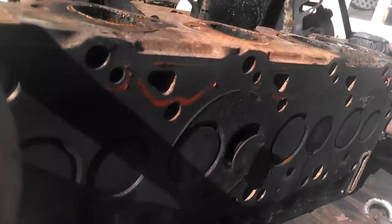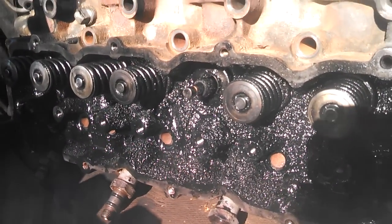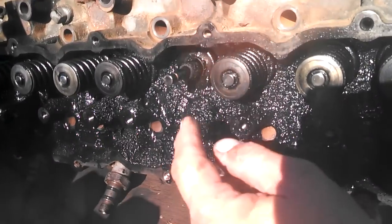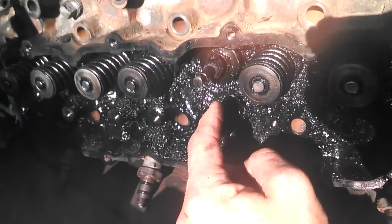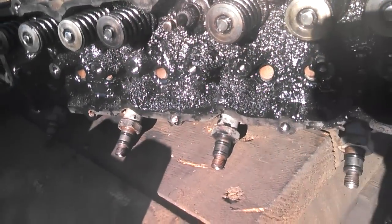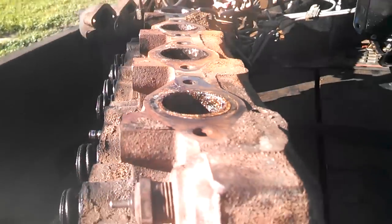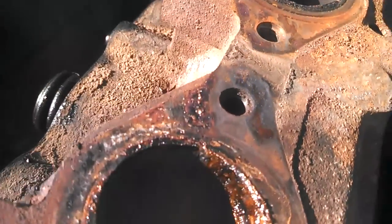This is the one that was chuffing for sure. On this side, look at how much play there is. What's happening is the valve is not able to fully seat properly when it's closed, to cool the edge of the valve's face — it's vibrating and just not able to fully close properly. So all of this shmeg you're seeing here is blow-by, combustion soot. I think what happened is we had so much blow-by, and that valve was the one that was chuffing — over time we had issues.